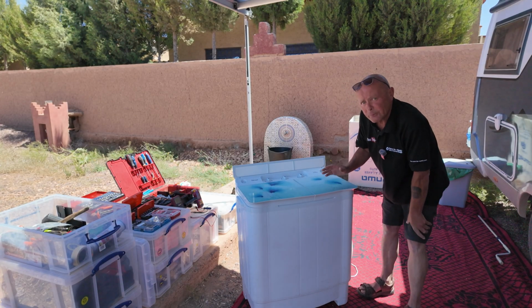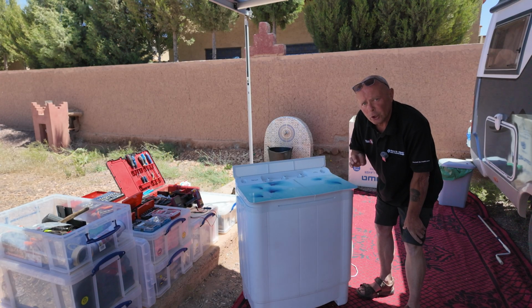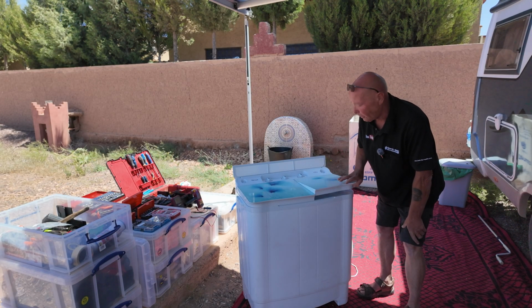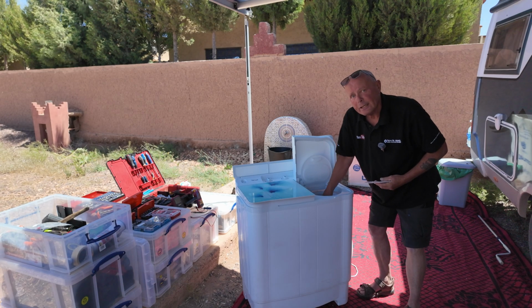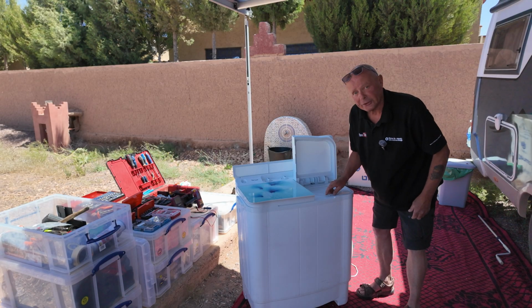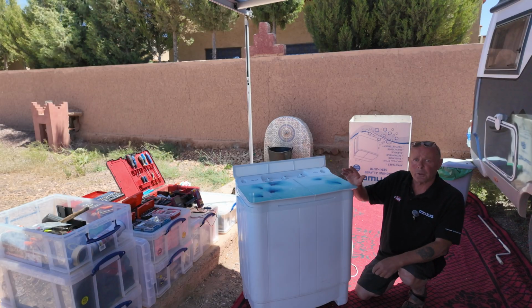Also, when it comes to the spinning side, if you hear the drum banging against the side of the cabinet, this means the load is not even or distributed correctly in the drum. Turn the machine off, let it stop, open up the door again, take the mat out and reposition the clothing so you get a more even spin. Put the mat back down and start again. Doing these things will prolong the life of the machine no end.